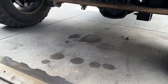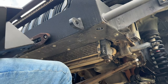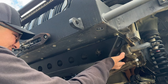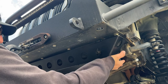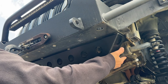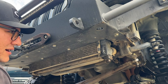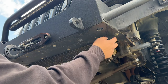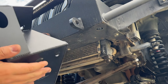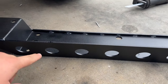Don't worry about the oil leak. I'm just gonna hold it up and see — like I said, if I need to cut it more, if not we're gonna send it. This thing does have the holes for the radiator. I'm gonna undo these bolts here, put it up, and then put the bolts in — that should hold it. It's pretty simple to do, and these rubber pieces here, there is a hole on the radiator skid right here where it goes into, so everything is locked in.